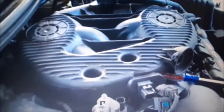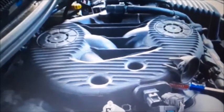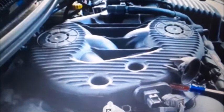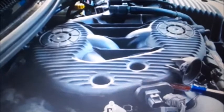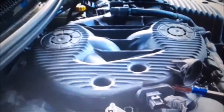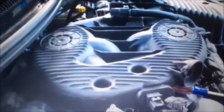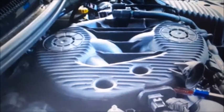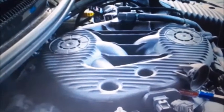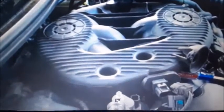At this juncture with the screwdriver lifting the front of this thing up, you could just continue and get all four bolts out of that water yoke and go ahead and finish your job. For our application, we had a lot of dirt and debris on top of the motor just underneath this intake manifold, and we were concerned that just raising it up might let items fall down inside the engine. Once you remove this intake manifold, you can actually see the backsides of the valves inside the motor. If you have a real clean engine without a bunch of debris, you could probably just remove the four bolts and that water yoke and be done with it.